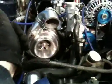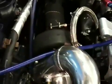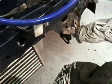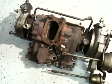Stock twins — this thing is ball bearing, so it must be better than the stock twins. There are some technologies that will make it more efficient across a larger range than the stock twins, but that's not what it's all about. This thing is designed with an exhaust housing. This exhaust housing stays the same size the whole time you're running it — that doesn't change. Just like blowing air through a vacuum hose, there's only so much flow that's going to go through that hose. It can either become a restriction or it can be too big. On something like a T04E, it's too small for the amount of exhaust that the rotary engine outputs in normal operations.